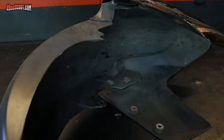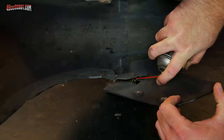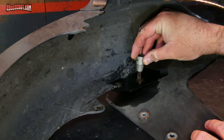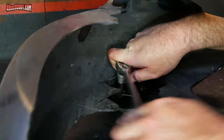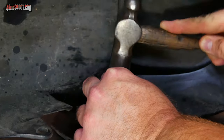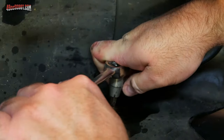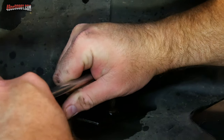This may be easier said than done. Normally I'd grab an impact driver when I can't get something like this out, but there's really no room and it's plastic, so for now I'm going to spray some penetrating oil on these and let that sit for a few minutes. I'm also switching over to a different driver. Fits as snug as anything I have. Got 3 out of 4, but this last one just wants to slip. I'll give it another try. There it goes.